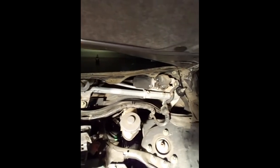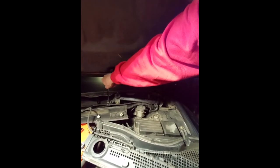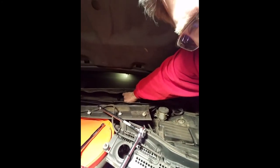Now we're getting to the nitty-gritty. Got a 10 millimeter ratchet because there are four bolts to remove off the linkage and motor. I went ahead and turned it on — you can see the motor is driving the two arms; through gears they turn the threaded rods that each wiper arm sits on. Got three of the four bolts out. Make sure you have your socket extension because some are hard to get to. Once loose you can hand-torque them out — they've got a washer attached, so don't drop things.